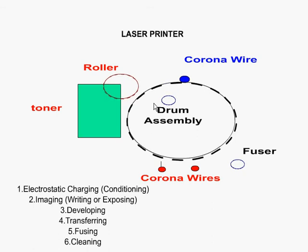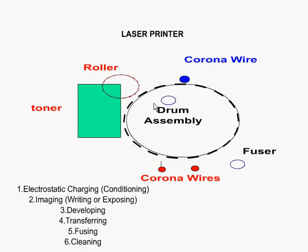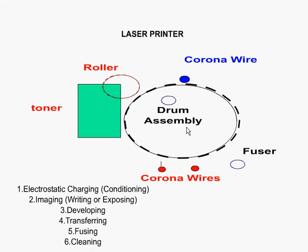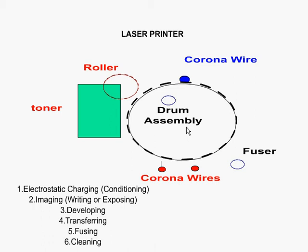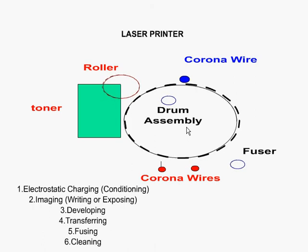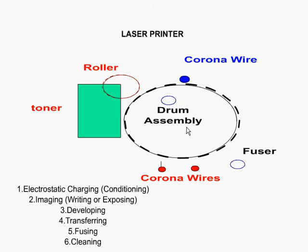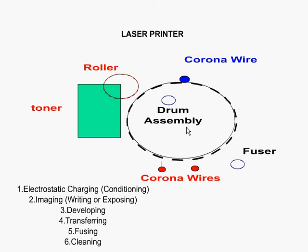The last type of printer is the laser printer. Laser printers are mainly used for businesses because of their increase in speed over other printer types, and the quantity and quality of the work produced. Laser printer quality is measured in dots per inch. The printer receives data from the page and breaks the data down into single strips called rasters — this is called rasterizing.